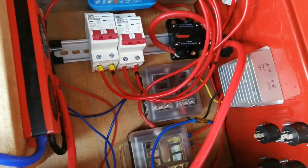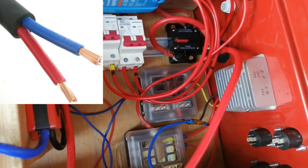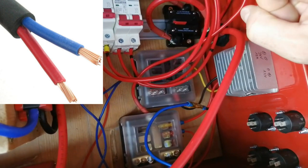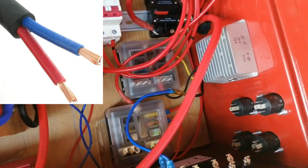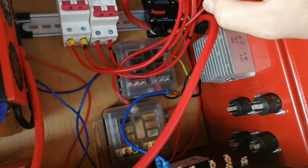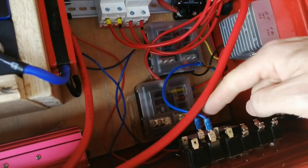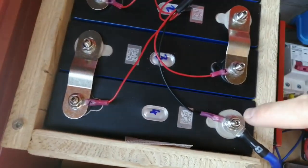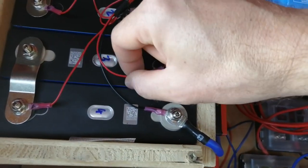For the load and everything - for the switches, lamps, pumps, whatever - I use 2.5 millimeters, which is 14 gauge. I use the wires from speaker cables because you can get them for a really good price, they're 100% copper, and I just remove the outer layer of the speaker cable. Then I have high quality 2.5 millimeter wires for my load. Of course you still have the problem with corrosion since it's 100% copper and not tinned, but I will see how it goes in the next years. I have heat shrink for the thin cables, which is quite convenient so that everything is fixed.